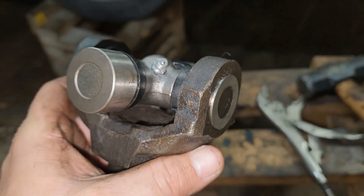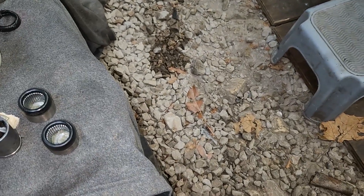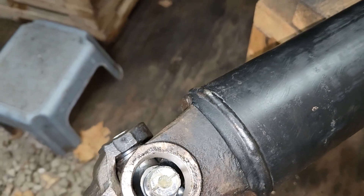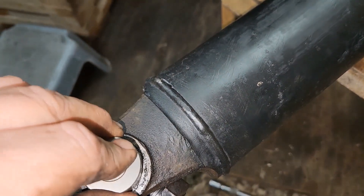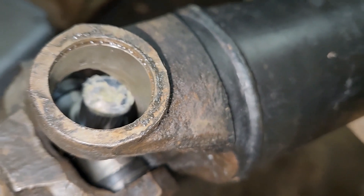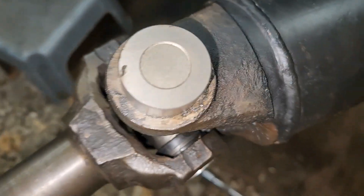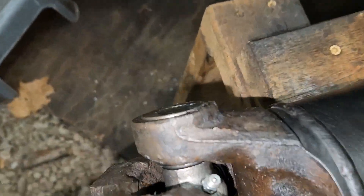That one's done. Let's put this on the driveshaft. I carefully took the caps off and set them right there. I slide that one through the bottom and then that one right there, and I'll hold it there and get at least one cap started in there. These are going to clip on that top groove with those clips right there. I'll have to go all the way down to get in there, so I'll hold this one up while I beat that down in there. Got that one started — going to go ahead and start the other one.